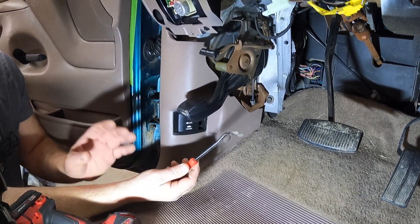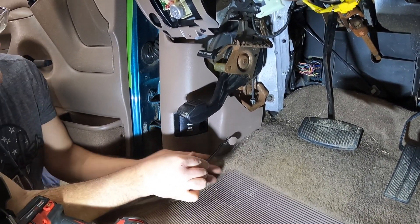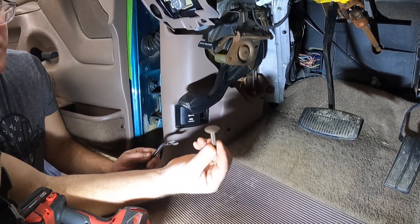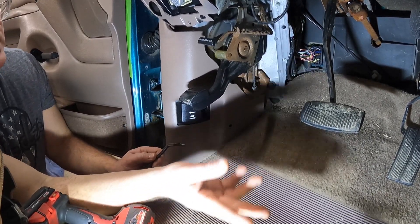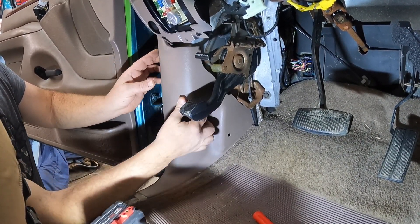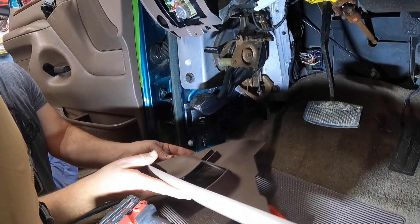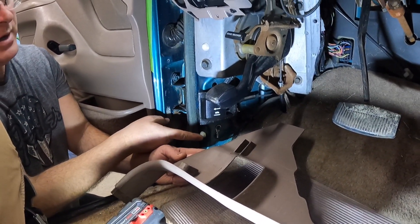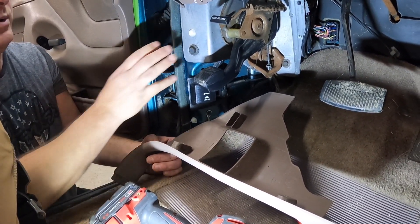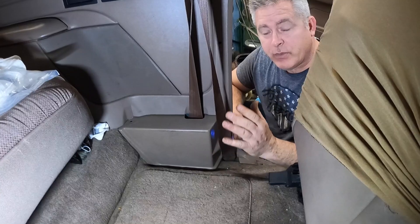The next step in accessing the door seal trim will be taking off your driver's side kick panel. Use a pry tool — I'll put a link in the description — and pull out this push pin. Be careful, you don't want to break these. They also make great push pins for your rear topper trim, and I do sell these. We'll pull the trim out — you'll want to lift it up slightly and then pull it back to release it from the pins inside. The pin stayed inside the truck. I like to have the pins inside the actual part before putting it back on. Right now the seal is exposed and you can tell it's all flattened out and almost touching the hinge.